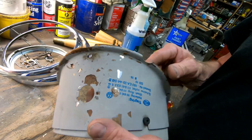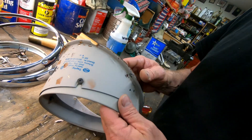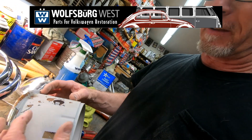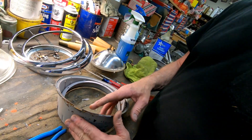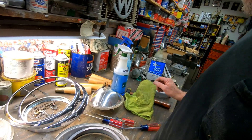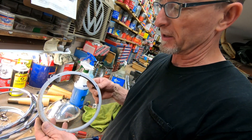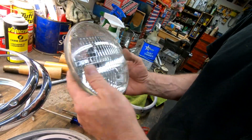There are really two styles. This isn't my favorite style because these little rubber grommets here usually go bad. I think you can source those at Wolfsburg West though. There's another kind that I prefer a little bit more — it has a little metal clamp on here. There's not much difference between these and a bus, really. The differentiating part is the only part that's different between a beetle and a bus is where you orient the headlight.